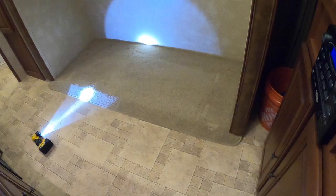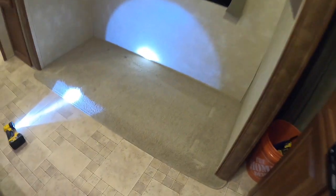One thing to check that I saw on the interweb is that when the slide's in, some of the slides actually lay down and slide on the carpet when they come in. Whereas mine's a rack and pinion. And I'll show you that here in a minute. And we can see how much crud and stuff's down in here, but I don't know if you can see that or not. Let me spin this upside down. And I actually float above the floor. So there, I stick my hand in there. You can see that. I'm actually floating a good inch above the floor all the way around this slide because it's a rack and pinion. So you might want to check that. And if yours goes and rides on the floor, you might have a problem.